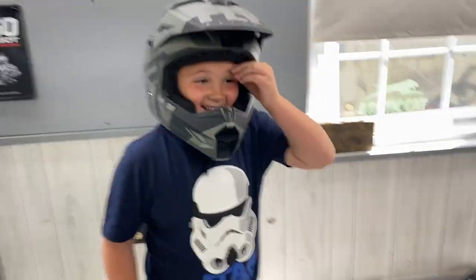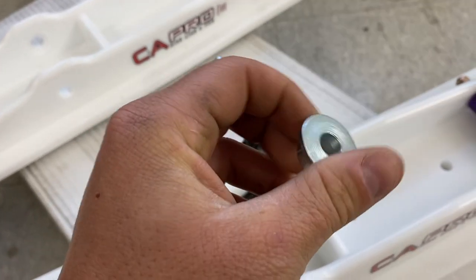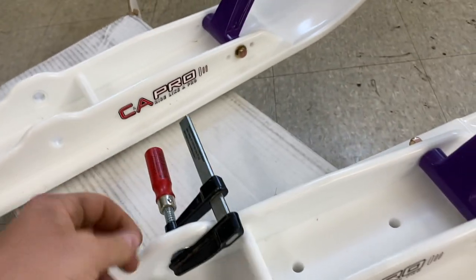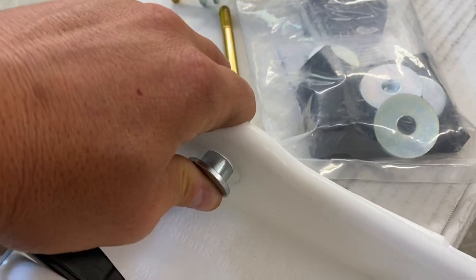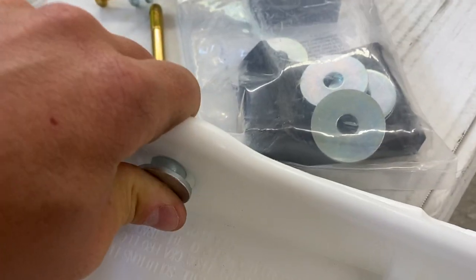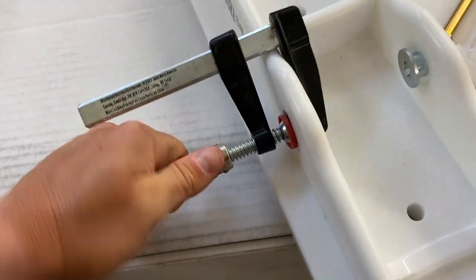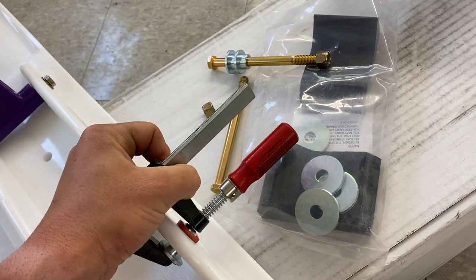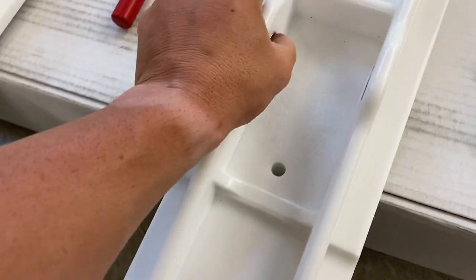The ski rubber is super worn out, so I'm glad we're doing these skis. As I was talking about earlier, you have these bushings — nice ones, CNAs — these are your ski bushings that go in your ski right there. Sometimes they push in pretty easy, other times they don't. If they don't, you've got to get it started a little bit and then use a C-channel clamp to just screw them in.